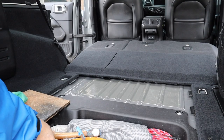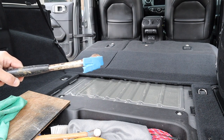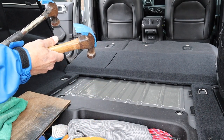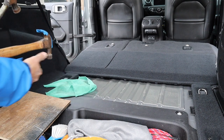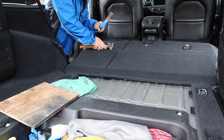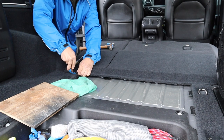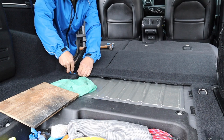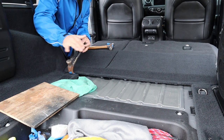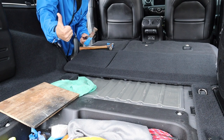I've used the edge of a hammer with some tape to protect the paint finish of the Jeep. I also put a little piece of wood there to provide some leverage, as you will see. Any type of wedge tool will suffice. You can see here I'm just putting the claw of the hammer between the plastic carpet-covered gap cover and the metal plate in which it is stuck into. Then I just have to wedge it in there and pull it up — simple as that.